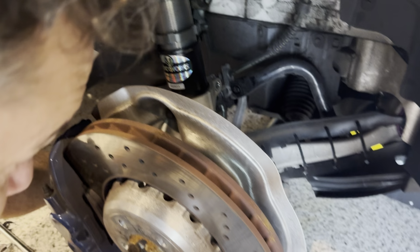This one is our right hand. We're gonna do this one first. So we've got our strut mounts. We went to put it in the other day and it looked like we had the older BMW that only had the 3-bolt. This is the 5 with the stud for the strut brace. So the instructions from the guys at Shockworks were to have just touching preload. So that's what we've done here. So that's just basically so it's not rattling around, and ballpark length. We're set kind of on the length of the strut here. So we will definitely be adjusting that shortly.